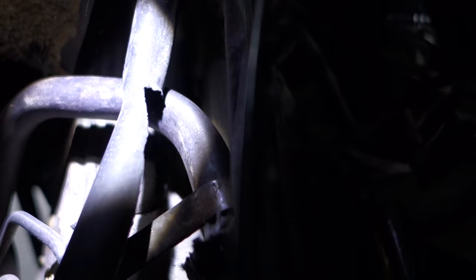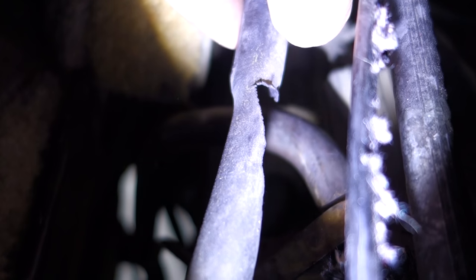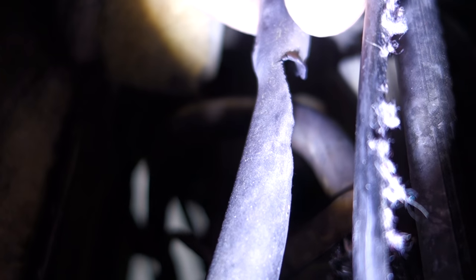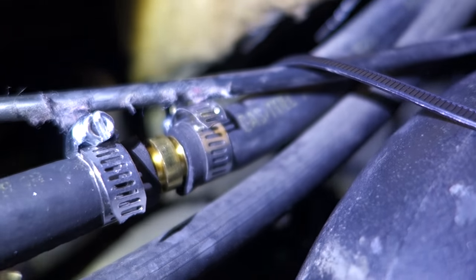I was just about to put the engine cover on when I noticed something that caught my eye. This hose right here has been melted through by the EGR tube, which is the metal piece right there — and that is fuel line. Hopefully I can just use one of those little splice kits and splice it together so I don't have to replace this whole line. It's the type of hose — I'm pretty sure it's an emissions part, part of the fuel vapor recirculation system. But I need to get that replaced. There we go — it's all fixed up and secured with a zip tie up to the air intake tube, so it will not be hitting that hot EGR tube!